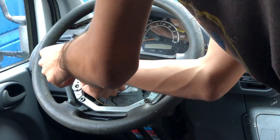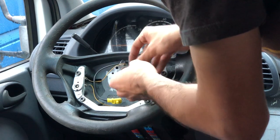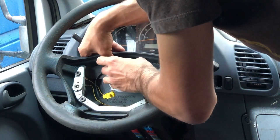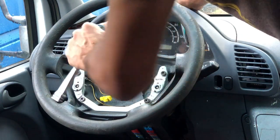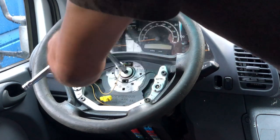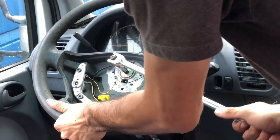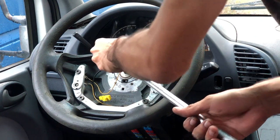It should be right about where you left it. Remember to connect the yellow wire from this, and on the left side of the steering wheel connect the black wire to the upper terminal. Now I'm just going to finger-tighten the bolt back into the steering wheel, then tighten it with the ratchet while holding the steering wheel. I'm going to have to switch to the breaker bar now.